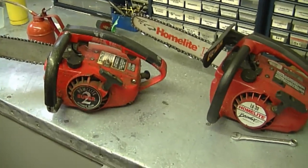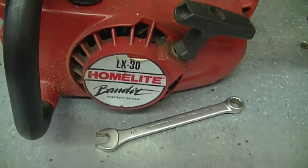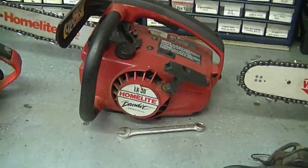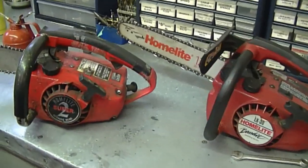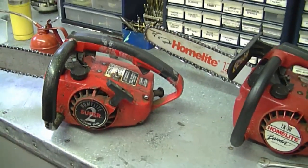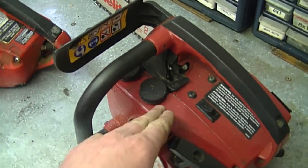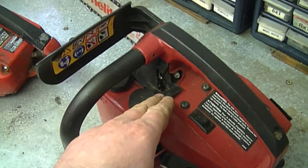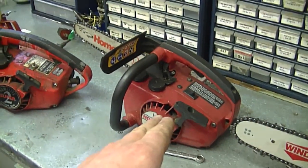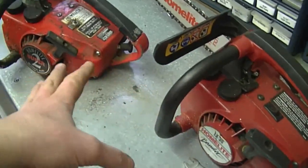Another question I often get: are the Homelite Super 2 and Homelite LX30 chainsaws similar when it comes to replacing parts? Yes — they're basically the same chainsaw with a few subtle changes. The carburetor removal is the same, and they use the same carb kit, though some carburetors have two adjusting screws and some only one. I have a video in the works to replace the carburetor kit in this chainsaw because it's very hard to start even after turning out the L and H screws. Hopefully this winter you'll see a carb rebuild video on this — so if you have a Super 2 or LX30, it'll be the same procedure. Thanks for watching, have a great weekend, and I'll see you in two weeks.